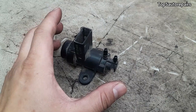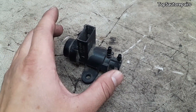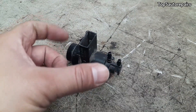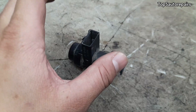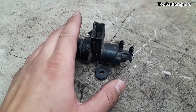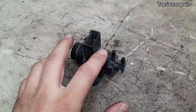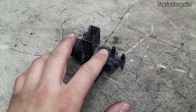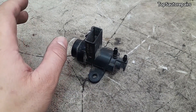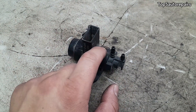If you have a bad habit of constantly filling up your gas tank completely — for example, when you're pumping gas and the nozzle keeps clicking off but you keep trying to add more fuel — that is not a good idea. Your charcoal canister will become full of fuel, which will damage it. And when the purge valve solenoid is stuck open, all that gasoline flows into the intake manifold and combustion chamber, again upsetting the air and fuel ratio.